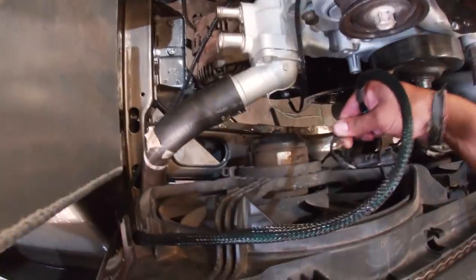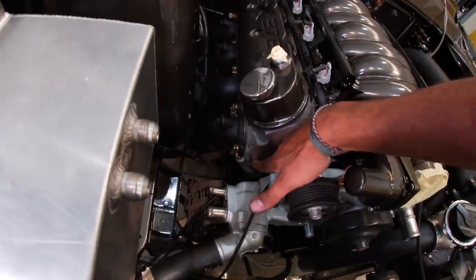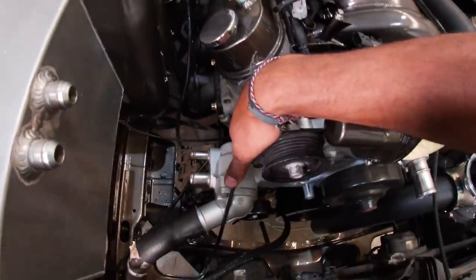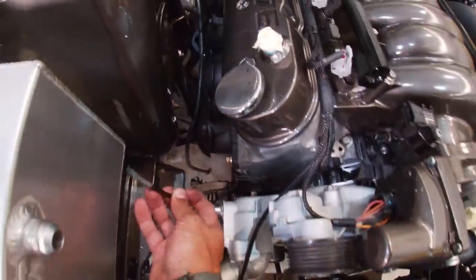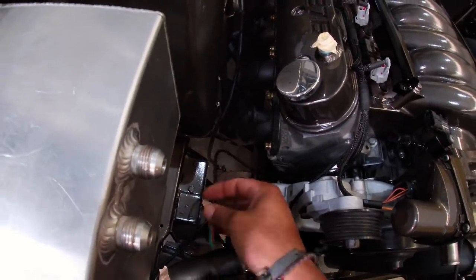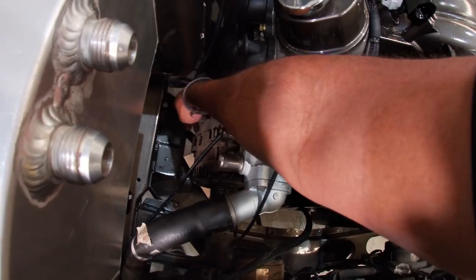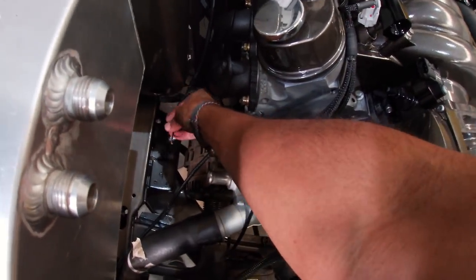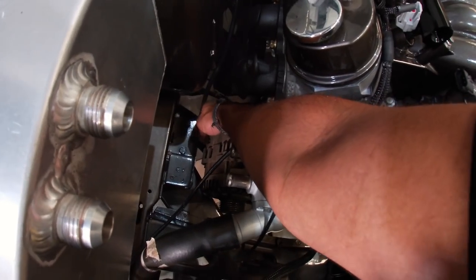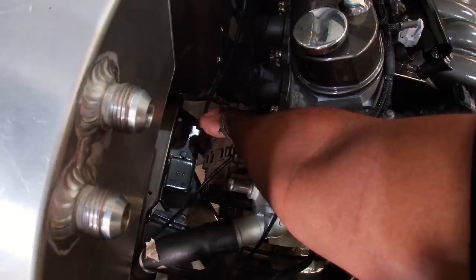Important to note - I've matched the gauge of the fan wiring. There is a ground here as well so that ground is going to ground to the head of the engine - just a good solid ground. This wire down here is our alternator control. We're not going to use a globe in this case to excite the alternator to start it charging - we're actually going to try and control it through the ECU like we mentioned in one of the first two episodes. So the plug for that is down there and we'll put a plug on that as well.